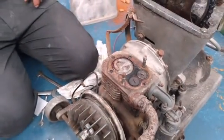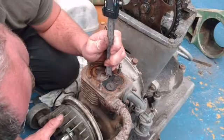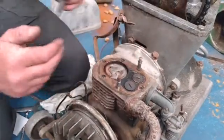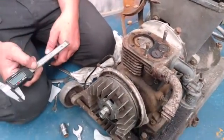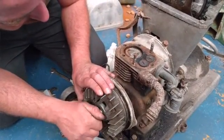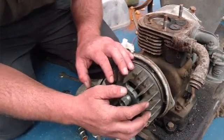To time this engine up we need to measure three sixteenths of travel with the piston - three sixteenths from the top. The piston's now three sixteenths from TDC. At this point the points - with the piston three sixteenths down from the top we should have the points just open. So now we need to just back this nut off ever so slightly without rotating the engine and set the arrow back to this ridge. Then visually inspect the points to make sure they are just opening.